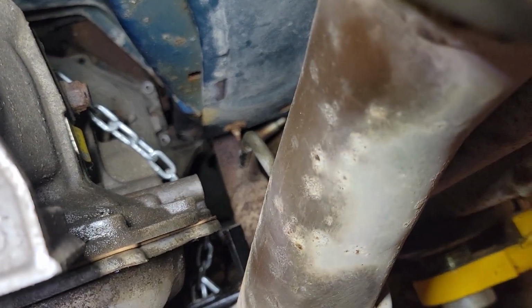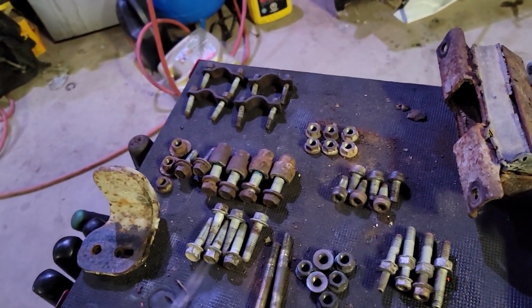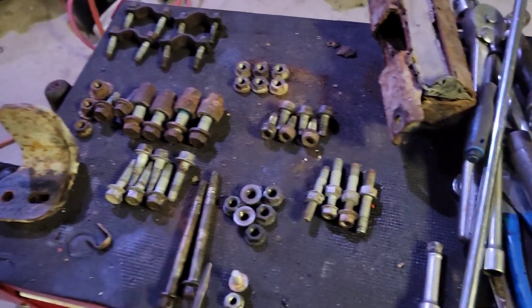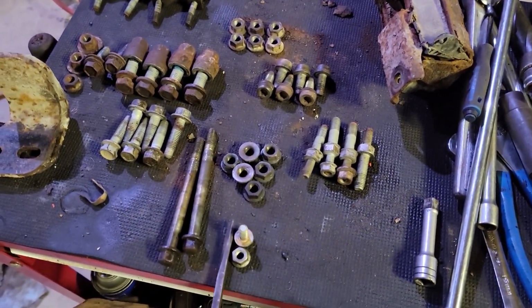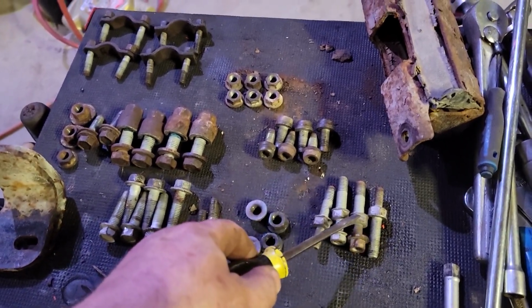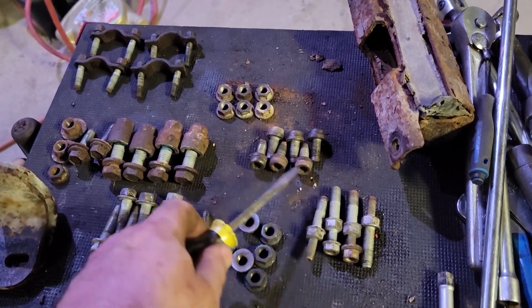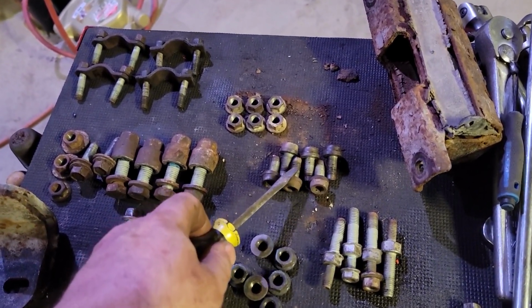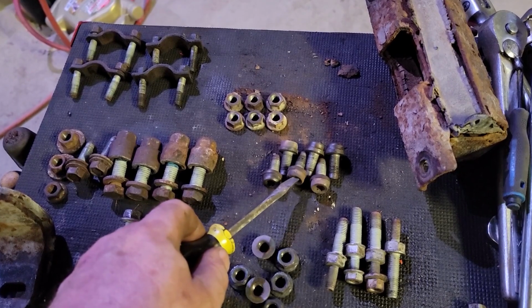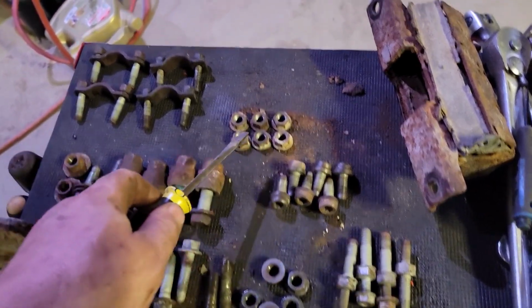They're basically lined up. Okay, so to give you an idea of what's involved in pulling a transmission and transfer case, these are just random brackets, bolts, starter bolts, exhaust nuts, bell housing bolts, of which there's actually six. I have two started in there already. Torque converter to flex plate. They're Allen heads. These are a pain in the you know what to get at. And they're the reason you got to pull the starter, because you can't get them anywhere else.